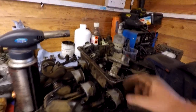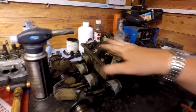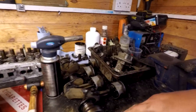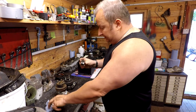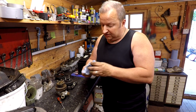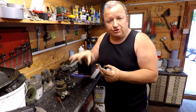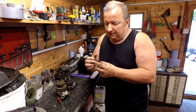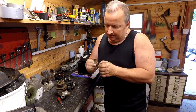All the engine cases have got to be cleaned up and that's all got to be done. I did manage to break a piston ring while examining them, but luckily I've got a replacement. A lot of people say you should put new bearings in, but to be honest these bearings are in very, very good condition — there's virtually no wear at all. These bearings have worn to that actual crankshaft, so it's a bit pointless just putting new bearings in for the sake of it. I've kept them in their original order — there are no score lines on them whatsoever, they're absolutely fine.